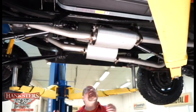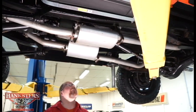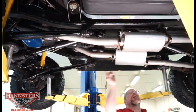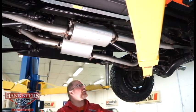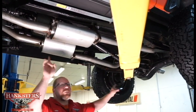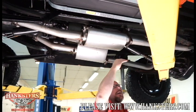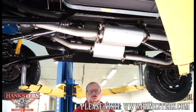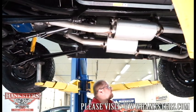As far as our floors go, they look really good on this particular vehicle — all stock floor pans with the factory stamp floors; you can see all the lines and all of the bracing is intact. We've got the e-brake all hooked up, so you've got your front cables, intermediates, rear cables, and all linkages in between. This has been upgraded to an electric fuel pump. We do have dual fuel tanks — the side tank up here is all brand new stuff: brand new tank, fill neck, vent tube, sending unit — all new stuff in that front tank.